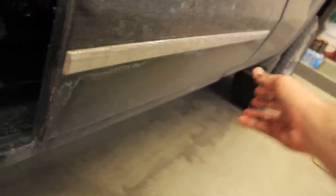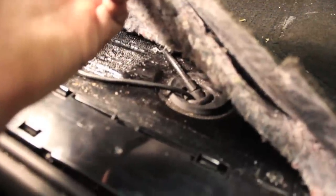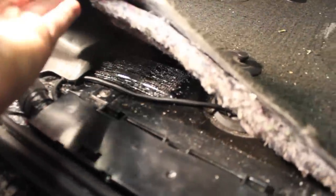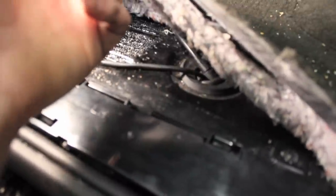Once you have the wiring harness running from the back of the truck, follow the OEM wire harness and run it underneath the truck all the way up underneath the cab. Then you're going to come through the floor at that grommet — that is the parking brake wire grommet. You'll have to poke a small hole in that grommet and fish your cable through. If you make the hole small enough, it should not leak.